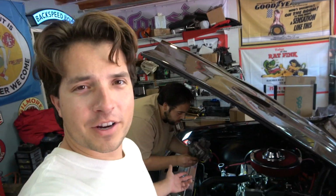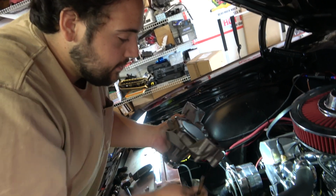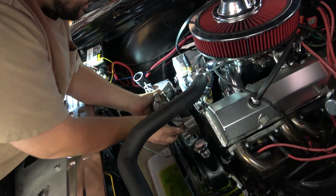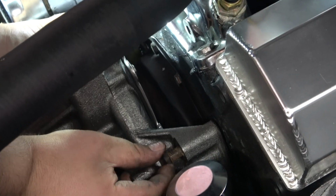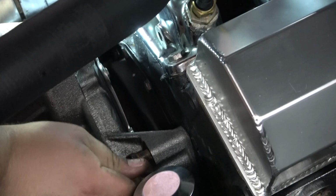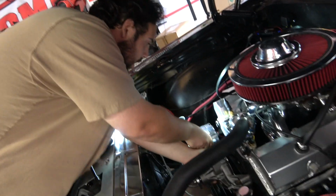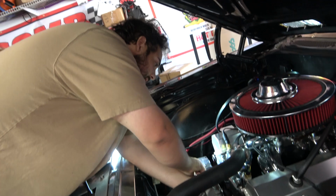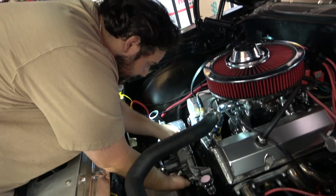Yeah. So before I knew it, Lenny's already taken over, and he's already got the water pump all lubed up and ready to go. I got all the gasket surfaces clean, dry, RTV. Yeah, so you gotta put some RTV around the gaskets on both sides. Otherwise, you will leak 100%. And Lenny knows best because he's done, how many? 20,000 water pumps before? Too many times.